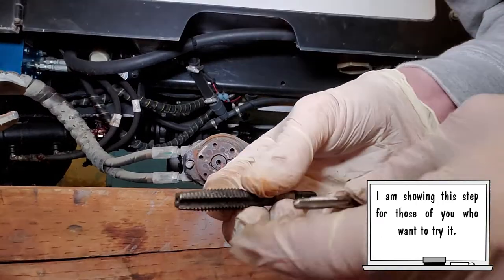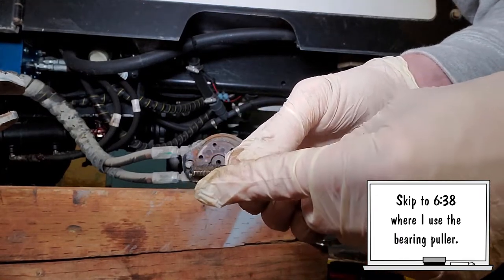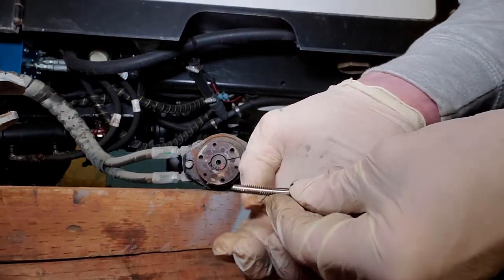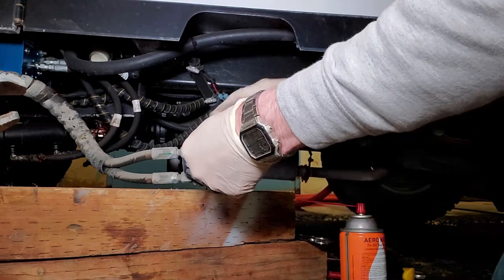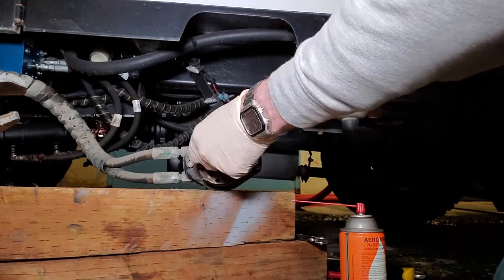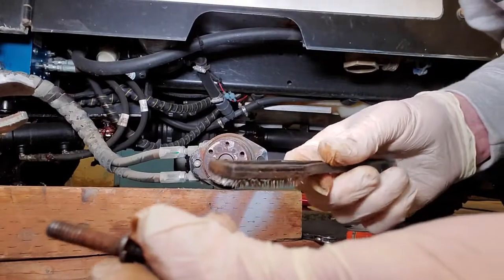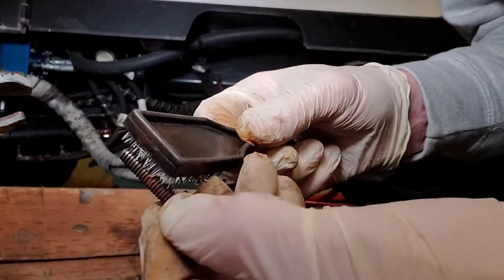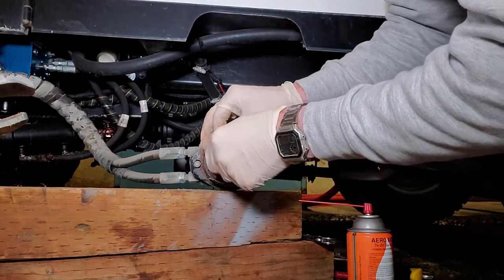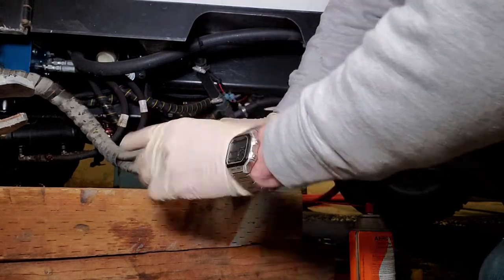I don't have a bottom-end tap — see how this one has a flat end versus that right there. This is the one so you get all the way down to the bottom. I think there's some space behind — I can still get that in there. Worst comes to worst, I can always cut that off. Ideally you want to spray some lube on there when you do this. Let's go ahead and see if that threads in any easier. The bolt's pretty corroded too. I'll clamp that down in the vise and use a wire brush to clean out all the gunk in the channel there. Let's see if these things thread in a little easier. I hate these taper locks — once they're locked together it's so hard to get off.